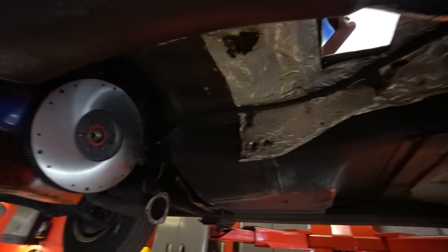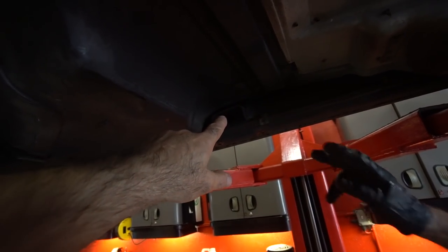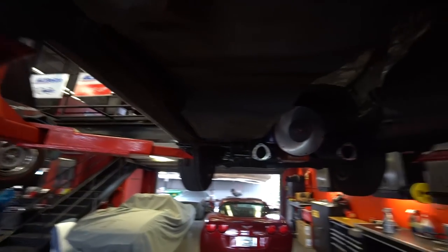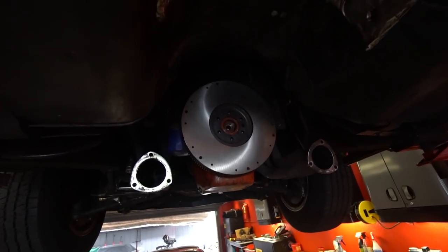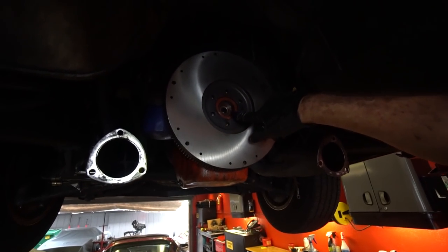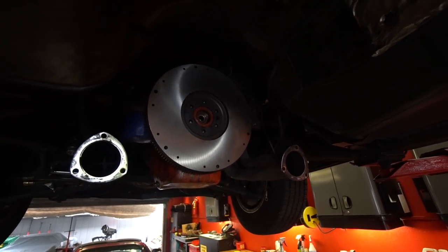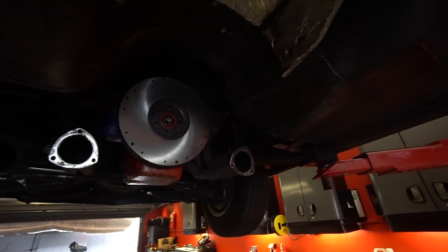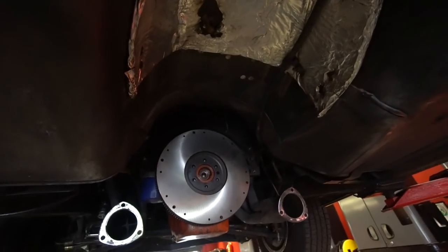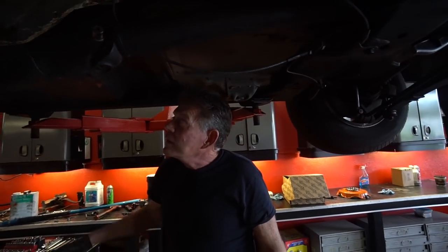There was an automatic in place and we have a removable cross member — bolt-in removable — going across here. Everything is the same as far as the drive shaft and the yoke on this 400, so it's really easy to do. Once you get the transmission out, you put your pilot bushing in, put your new flywheel on, a different starter, and start with your clutch. The ten-and-a-half-inch clutch was usually on the LT, so that's why we're putting a ten-and-a-half-inch in here. How long do you think it'll take to put everything in? The clutch will probably take about a half an hour.